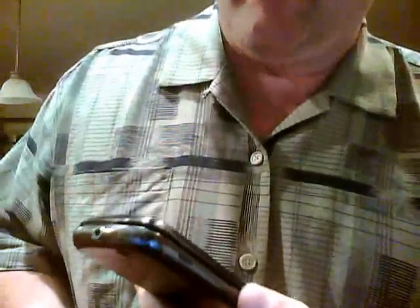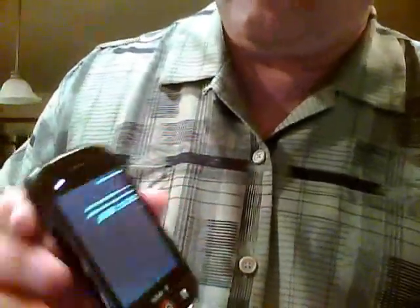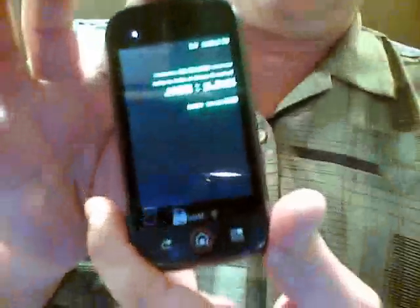So I just shut this phone down. I'm going to hold down the camera button, then tap the power button. I'm going to hold the power button down until it vibrates and lights up, then hold it for a second. I'm going to let go of that button and hold the camera button. You let go when it tells you to. Now it says you've got 10 seconds — I'm going to select volume down, which is recovery mode.